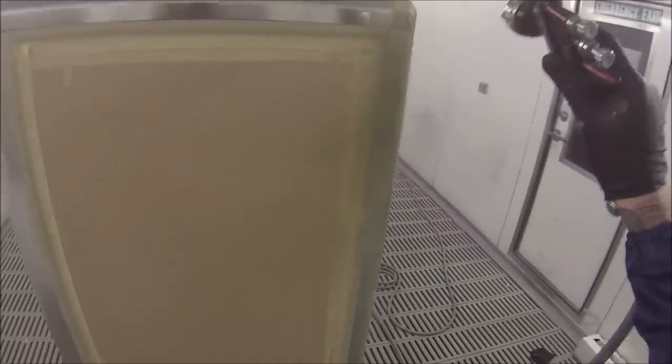So obviously we will end up getting a touch of the plastic primer overspray on our etch, but that's not going to matter because the etch is down first, it will still stick.